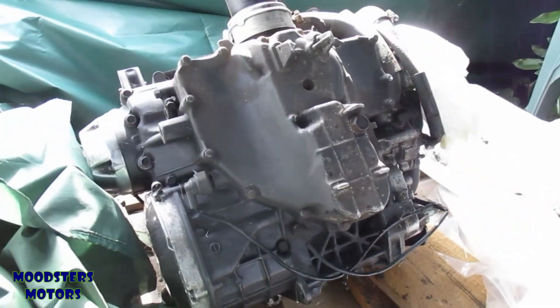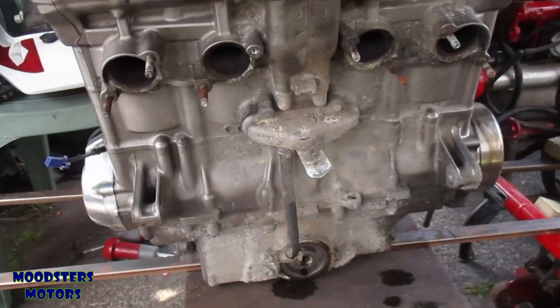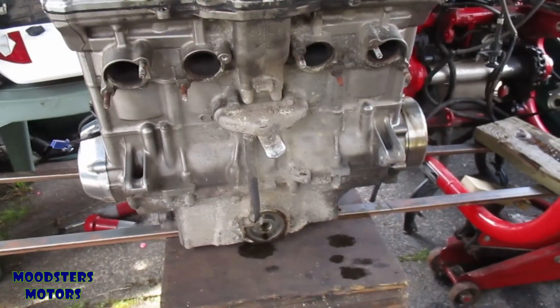Time to prepare the replacement engine: get the oil filter off, get the sump off, then swap the engine over. I think the engine caught on the old sump because it hangs lower than the mating face — I may have broken it off. Let's get the oil filter and housing off, then we'll swap places and get ready to put the replacement engine in.